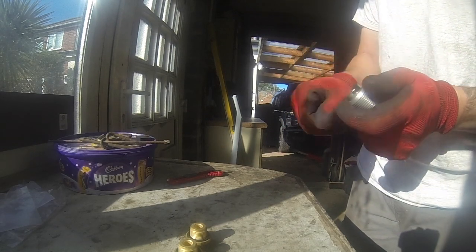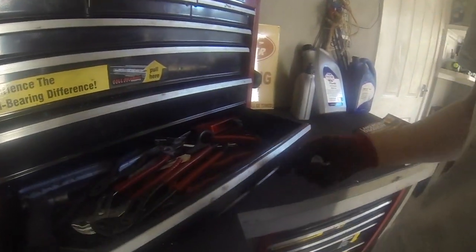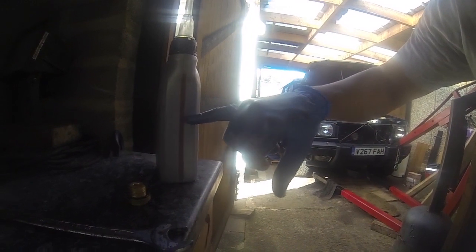So I'm going to go back under, screw these on and get some oil sorted. Like I said, the only thing that is needed is a ratchet, which sits straight in nicely. So refill time. What do we need? New filler plug if required, which takes a 21mm spanner, and the start of the 1.6 litres of oil. So that's 1 litre. I'll simply put all this in and then fill up to the 6, put that in, and then we're done. Simple as that.